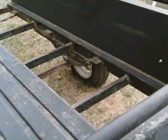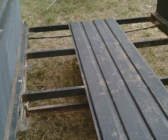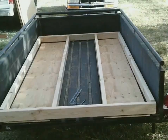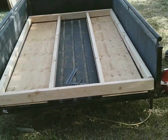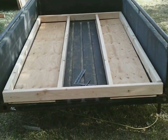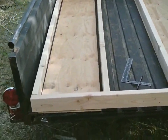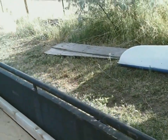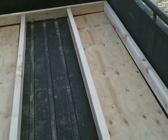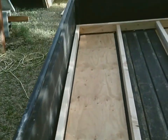The old floor panels — some really old, bowed and warped half-inch plywood — were removed and replaced with fresh half-inch plywood to give a nice even platform. Now the floor framing begins using two-by-fours. This trailer isn't the same dimensions as the Lowe's trailer in the plans, and yours may differ too.